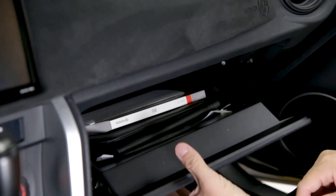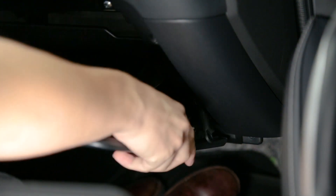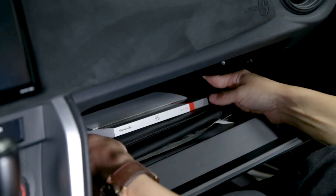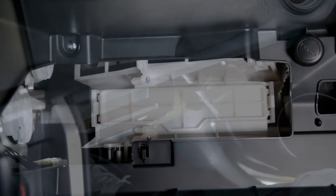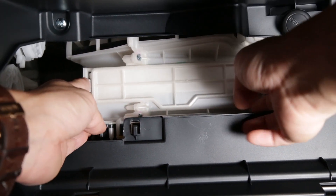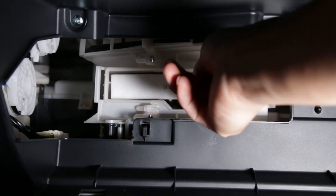While we wait for the oil to drain, it's a good idea to check the cabin air filter because it's what filters most of the air that you breathe inside the car — especially important if you or anybody who rides in the car has allergies. It's right behind the glove box. To get behind it, open the glove box, kick out the tab on the glove box support, push in on these two tabs and the whole glove box can be removed. Then press in two more tabs to access the cabin air filter.